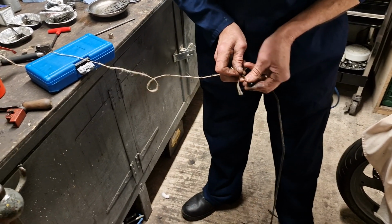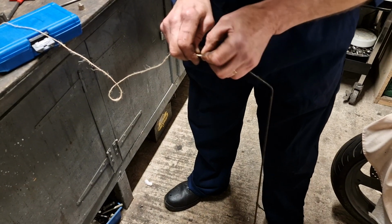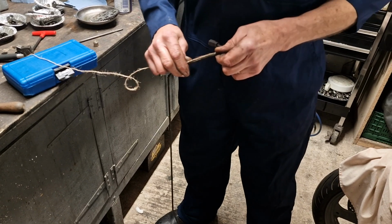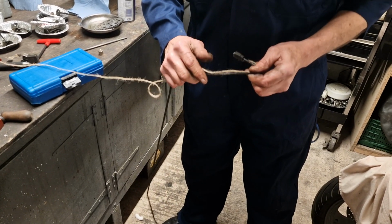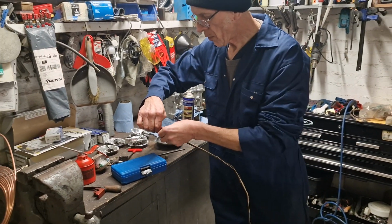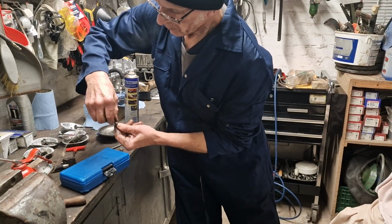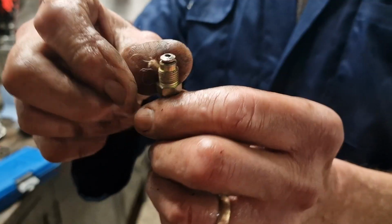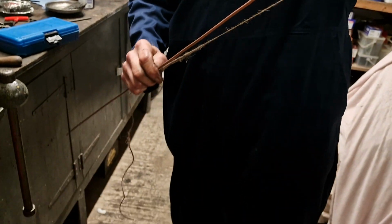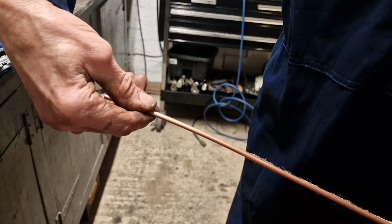So this is the old brake pipe, and what Dad's doing is not overly technical, but does the job, using a piece of string to measure exactly the length of the existing brake pipe. Again, no massively fancy techniques needed, just some old garden string. So we've got an end on the brake pipe now and measuring that cut pipe. See how close we were.